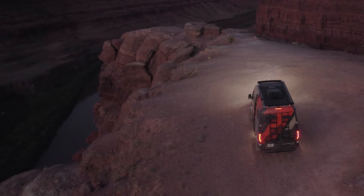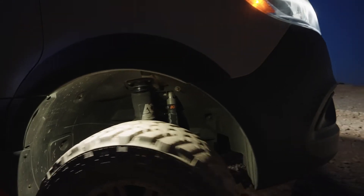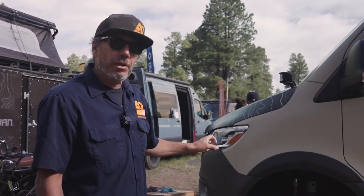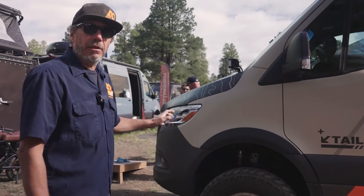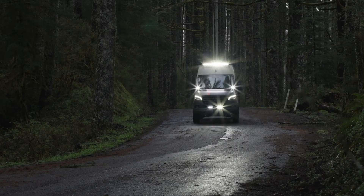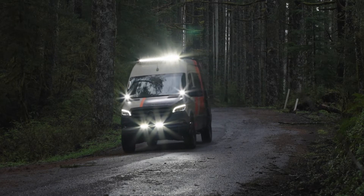This has an auxiliary Fox shock in the front. We've done a lot of work to position that auxiliary shock exactly where we want it. We're stroking that shock exactly five inches — that's where our off-road experience comes in. It's not just eye candy; it's actually doing something. We can tune that shock if needed, and we have these shocks especially built for us by Fox. They work out really, really well.